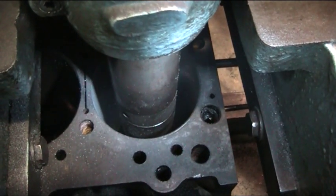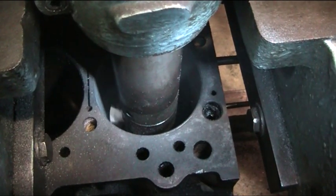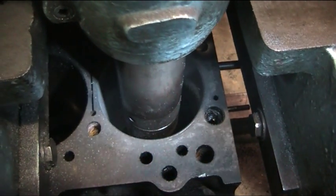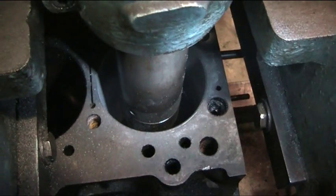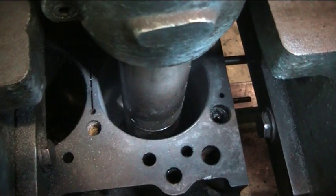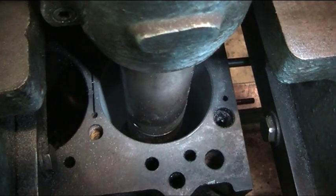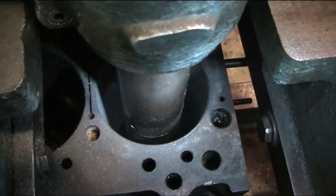This machine has 6 different speeds; we like to take it nice and evenly calm, a nice smooth cut. When the cylinders are cut, the honing process only takes a small while — we may take another 2-3 thousandths out with the honing stones to get the correct fit and the running clearance for the pistons.